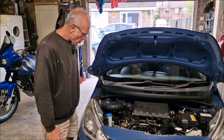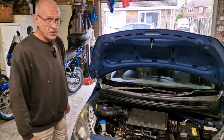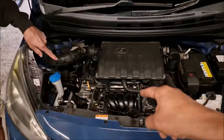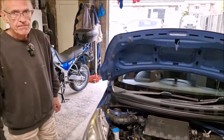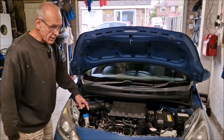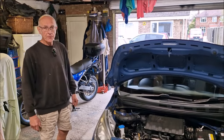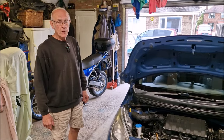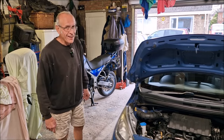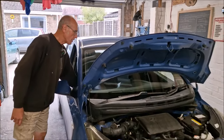So you've done some diagnostics and you've taken a belt off. I've took the auxiliary drive belt off and it still does it, which tells us that it's probably something in the engine. Okay, so we're going to replace the timing chain. Worst case scenario is it's the variable valve timing things, but I don't think it is. What we're going to do by replacing the chain, can it make it worse? No. So we're not running the risk of breaking mum's car.